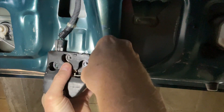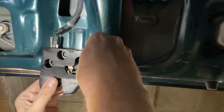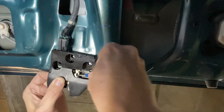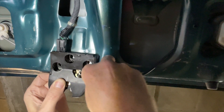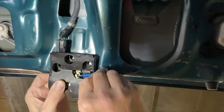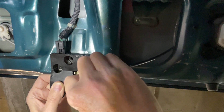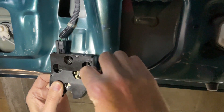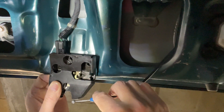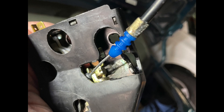With the bolts removed, the enclosure will come off but not quite, because it's still attached to that rod in the back. First we're going to remove that pulley that comes from the driver's seat, which comes off quite easily if you bend out the blue part and then wiggle the metal part with the ball at the end out of the mechanism. It's sitting in there quite loosely — make a quick mental note of how it's fed in there so you can get it back together later.